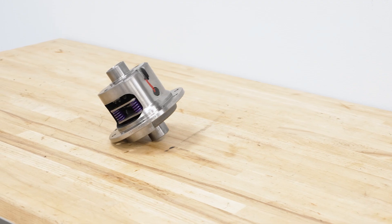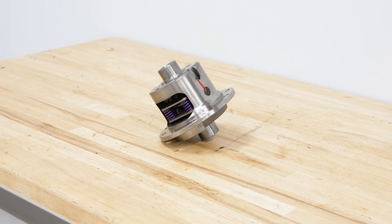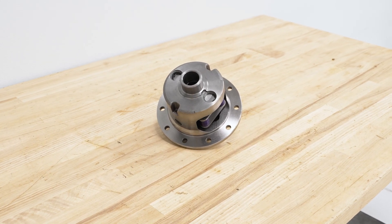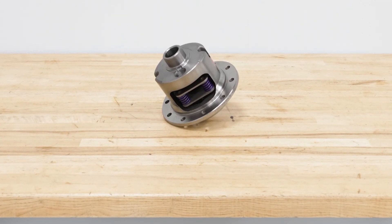In the center, instead of those free-spinning spider gears — if you have an open diff — this has springs that push on the side gears, which push on friction pads to keep that power even. When you're taking your Jeep off-road, adding larger tires, or adding any extra load, the factory ones can wear out fairly quickly.